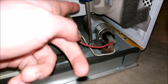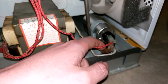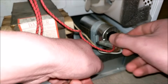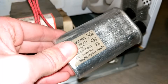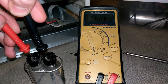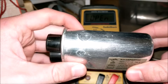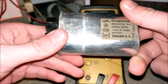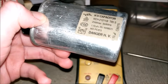Let's pop this thing out. Stick a screwdriver in there and turn the screw holding the capacitor in place. This screw will also probably be holding one end of the high-voltage microwave diode. With the capacitor out, unplug the leads connecting it and safely remove the whole capacitor. Our multimeter is still on continuity mode, so I'll check the continuity of this capacitor — and that is not a good thing. This capacitor should not be shorting. The capacitor is made of two separate metal plates inside, and if those plates touch, it no longer functions as a capacitor but as a gigantic wire. So this capacitor is most definitely bad.